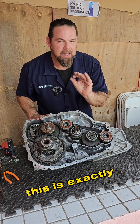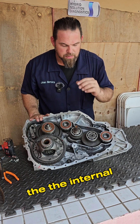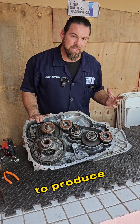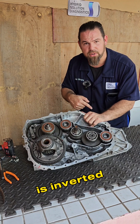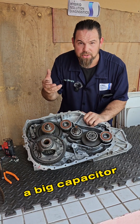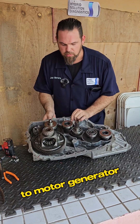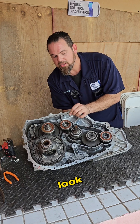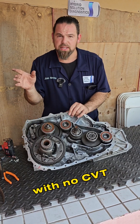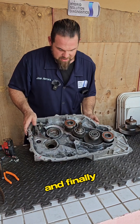Mechanically, this is exactly what makes the e-Power transmission so special. The internal combustion engine is only used to power motor generator number one to produce electricity. That electricity is inverted back to DC, and together with the high voltage battery — used here as a big capacitor — both are producing power to send directly to motor generator number two to drive the vehicle. There's no CVT, no gear ratio — it's just a direct drive.